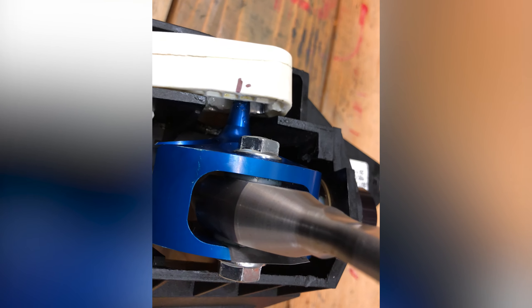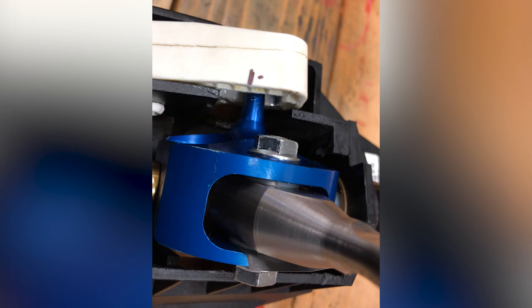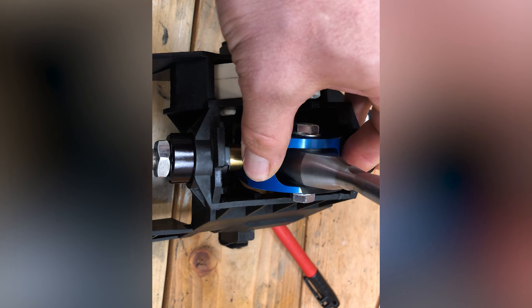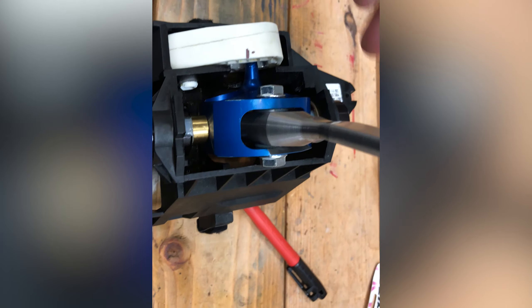Another update on this shifter — I noticed that when going back and forth it's nice and easy, but then you get to this point where it gets stiff and it also pushes this arm over and gets tight. What I realized is that down here the ball is engaged on the bottom and then the arm is engaging on the top, and when you force it over into reverse it's definitely stiffer. But this is adding to it, and it's really torquing in — this is the reason why there was a big groove I had to fix and probably why it blew through the bottom of the piece.